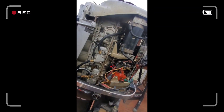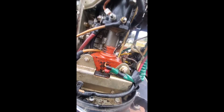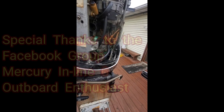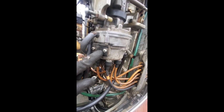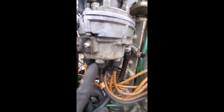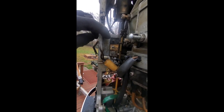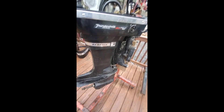All right, well there she is. There's a switch box and I did test the coil. The resistance came in kind of low. I was online and asked the question — Outboard Enthusiasts, if you guys are ever looking them up, tons of smart people on there. They said that these coils are invincible and I believe them. So I opened the distributor. I don't know what a bad trigger looks like, but everything is whistle clean on the inside. No corrosion inside the cap, nothing like that. I tested the switch box and it came back bad.